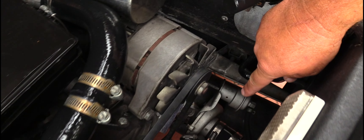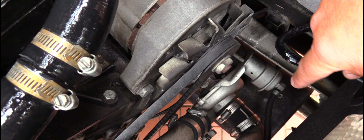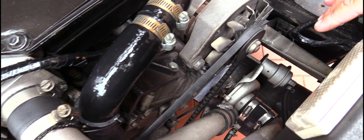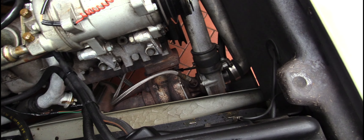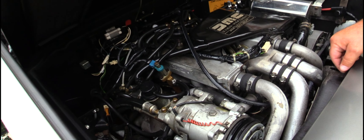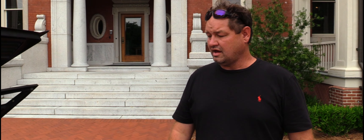In this light, you can probably take a peek down there and see the turbos. I do not feel a whole lot of power coming from the turbos, but they do work — the wastegates actuate. There's no intercooler system hooked to them; they just push some energy into the intake. There is a boost gauge on the right-hand side by the kick panel of the steering wheel. I see a steady 5 to 7 PSI that it pulls. You can feel the air, and when you let off it actually draws vacuum, so it goes into the negative.